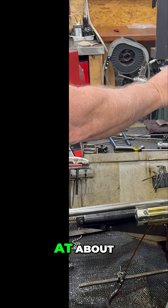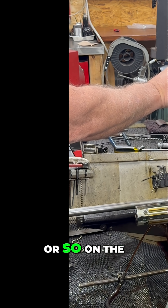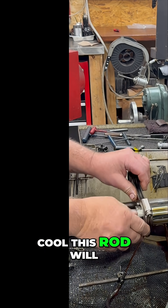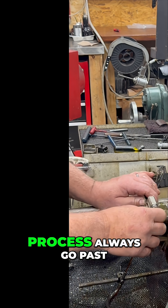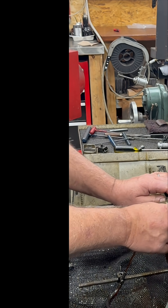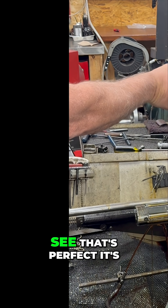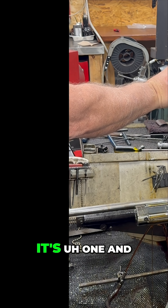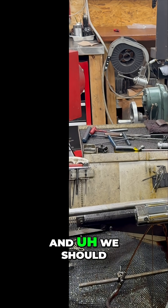I'm at about a thou and four tenths or so on the parting line, which is okay, and I'm at zero there. Let it cool. This rod will probably gain back a couple of tenths in the heat of the honing process, so I'll always go just ever so slightly past zero, a couple of tenths. That's perfect — it's a tenth over, and at the parting line it's one and two tenths. That's not excessive at all, and we should get a good result.